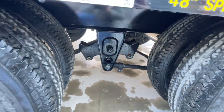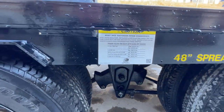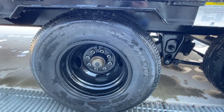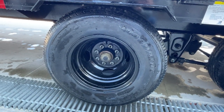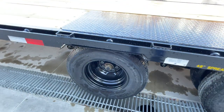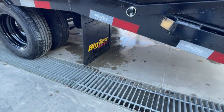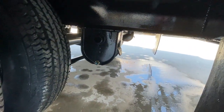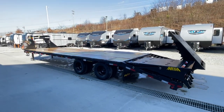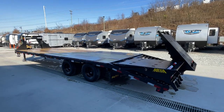There's your adjustment. These are Dexter axles — 48-inch spread axle — and it gives you your wheel torque spec. This is an oil bath hub, which just takes standard gear oil. You've got black wheels with a load range E 10-ply radial tire. The trailer also has a center mid marker light and mud flaps as standard equipment. The running gear on this is much heavier than most trailers. I can only assume that at some point BigTex made the decision — a few years ago — to go to HDSS because more and more guys are doing hotshot work, putting a lot more miles on these trailers than they used to see.